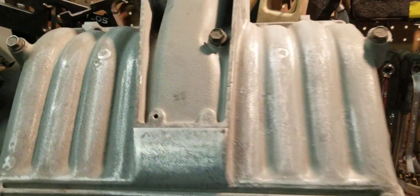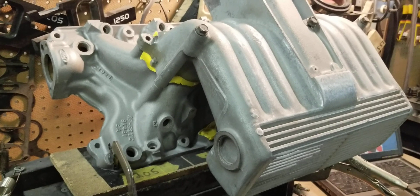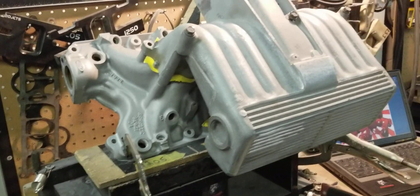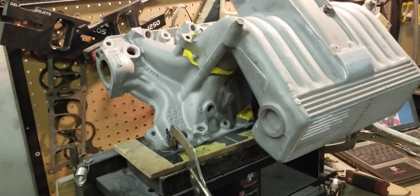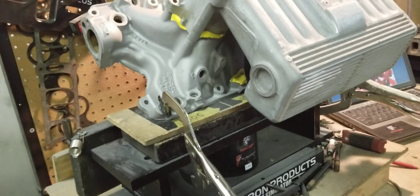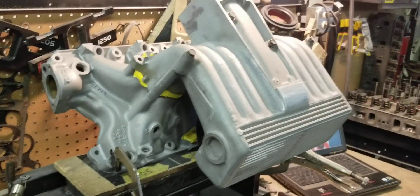The lower did have some gasket matching as far as any previous work done to it. Gasket matching really doesn't increase CFM — it's pretty much for cosmetics most of the time if you don't hit the ports, entry, the curves, the radiuses. So gasket matching, if that's all you're doing, it pretty much results in no significant CFM gain, especially when you have a stock upper.